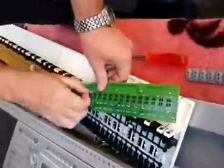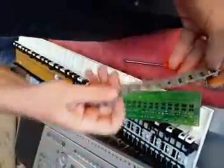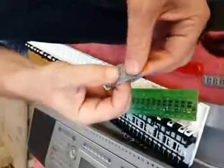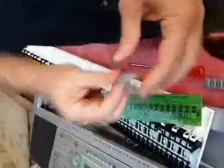Make sure that you put them back the same way they came out. You'll also see that there are little grooves on one side, whereas the other side of the rubber contact is absolutely straight. So we take these rubber contacts off, pour Handy-Andy all over them, rub them with the Handy-Andy, and put them under warm water. Once all the Handy-Andy and the muck is gone, put it outside somewhere in the sun to dry. Don't try and use heat — this is a rubber material and you don't want to bend or deform it in any way.